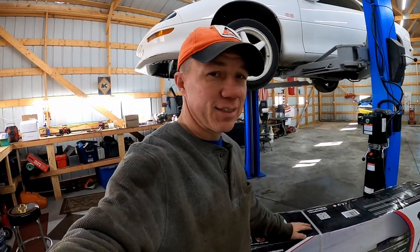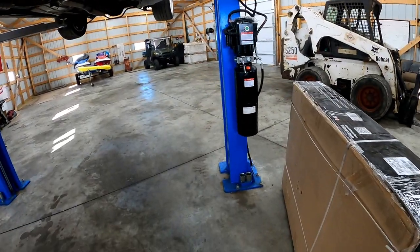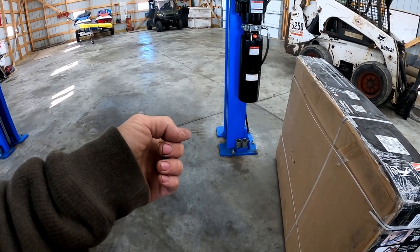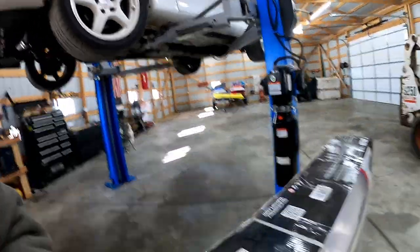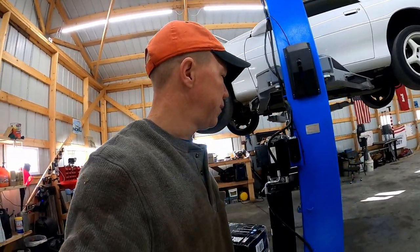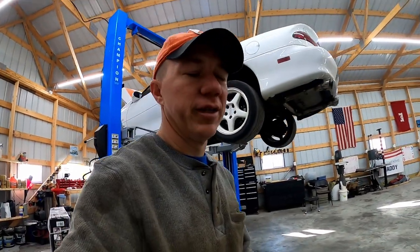The pad is six inches thick. To put a two-post lift in, you need at least a five-inch-thick pad. The two-post lift is wonderful — I love it. It's strong enough to lift our truck and everything. Super handy tool to have — I would highly recommend one.